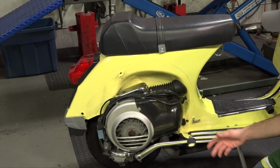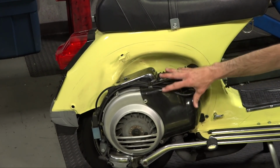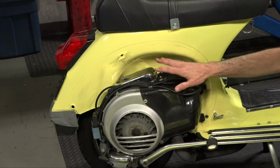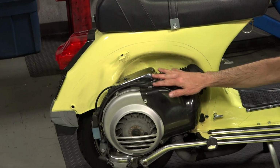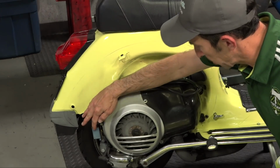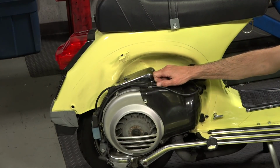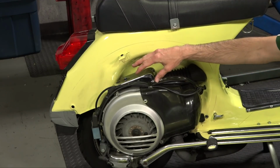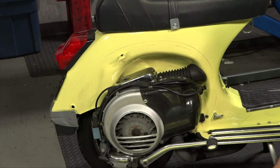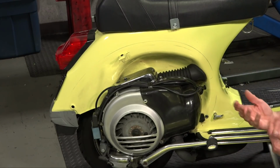As you can see, the cowl's removed to access the motor, do service. These are very, very robust designs for the vintage Vespas, and you get the added reliability of the electronic ignition. You can see somebody's upgraded that electronic ignition box with a little bit newer one. But it's not uncommon that I see this era of scooter coming with the original electronics, and it still sparks and fires and runs. Obviously things like gaskets and rubber seals have failed over the years,